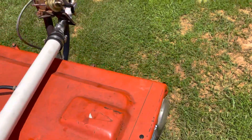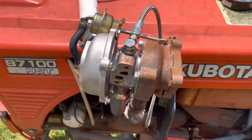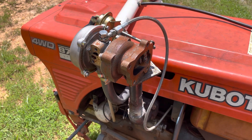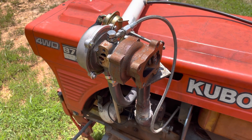We never even put an actual exhaust directly up to the turbo, so I'm sure that would have probably made the sound a little bit better. The wastegate never did try to open — I wouldn't expect it to. I think that wastegate is set around like eight or nine pounds from the factory.